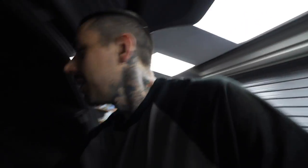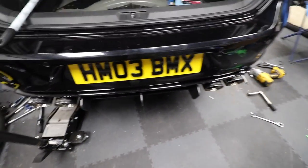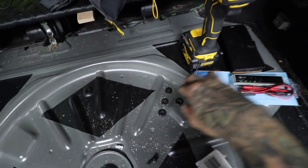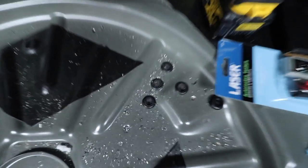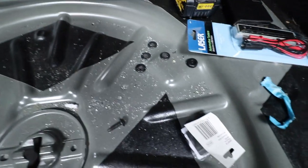Welcome back to the garage - we've already got started. We've drilled four holes for the airlines. A lot of people with show cars use plastic grommets but doing that you have to drop the exhaust and all kinds of stuff. I wanted to do it where I could fix it on the side of the road if needed. I've done one there and three there, staying in a gap underneath. I've put little rubber grommets in, pierced holes in them to run the pipes through, and we are ready to run some airlines.